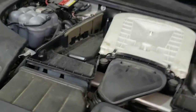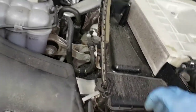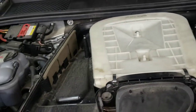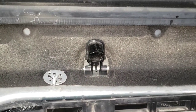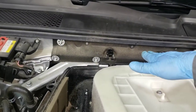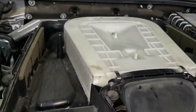These connectors you need to pull straight back. There's one on the passenger side as well. It looks like it's still attached in the rear — you need to go forward, so pick the front end up and pull forward. It slid out. There's a little pipe that slides into the back, so just like the top cover, you line up in the back, push it toward the firewall, then down. Lift up and pull forward.